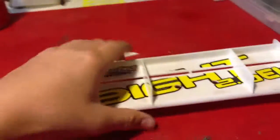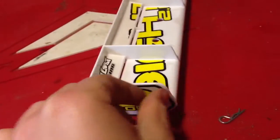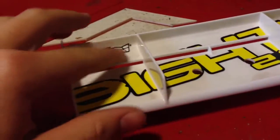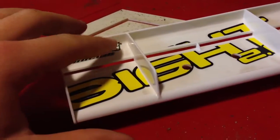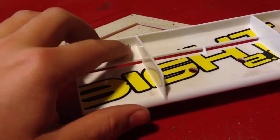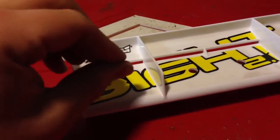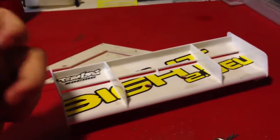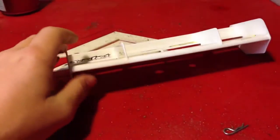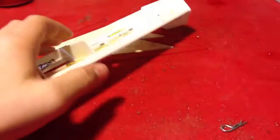Okay, enough of that, but just showing you guys kind of what it does. They lengthen the wing this way, and they pulled these side panels down, made these a little bit longer, and put the wicker bill system. That's where you can put some wicker bills on here. The bigger the wicker bill, the more downforce you're going to have on the back of the car, and that's for people that either have a really low punch engine or really like to get on the throttle hard out of turns. That's pretty much all that is.